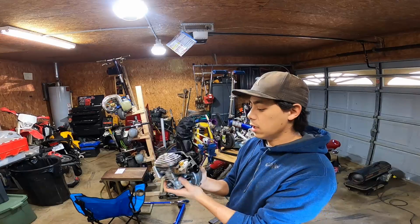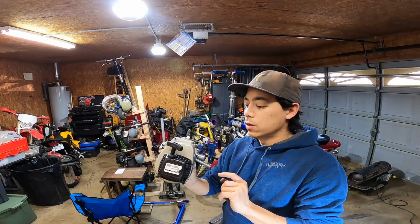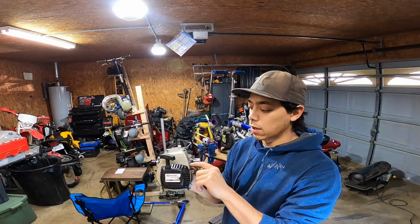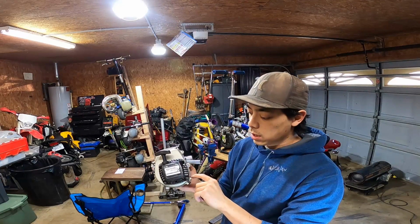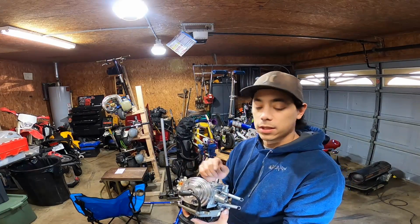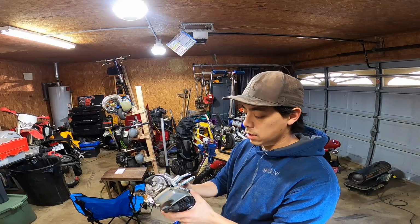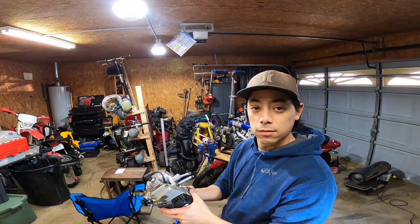But yeah, so it's got an RC fan cover on it, mainly because you can't fit an RC coil without using an RC cover. We're using an RC coil with an LH flywheel. I might switch to the RC flywheel after we get this thing running, but this flywheel is lightened. So let's put a spindle on it, stick it in the scooter, and go from there.